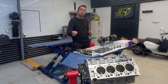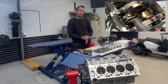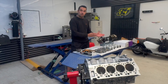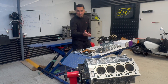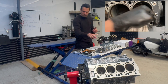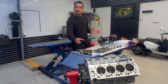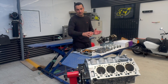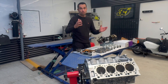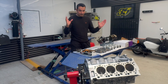If you watched the previous video where I did the teardown on this engine, you might remember that this crankshaft was completely busted — we had two spun bearings, it looked horrible. Thankfully we've been able to save the crankshaft; we didn't have to buy a new one because that's very costly. The block had scratches on two or three cylinders, and we've done my favorite thing with the S63, which is sleeving the block. We put cast iron sleeves in, which brings the block back to stock spec at 89 millimeters, while also reinforcing it to hold much more boost. We've also got brand new pistons and brand new rods.